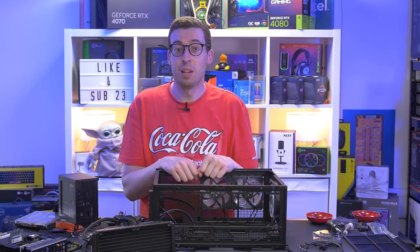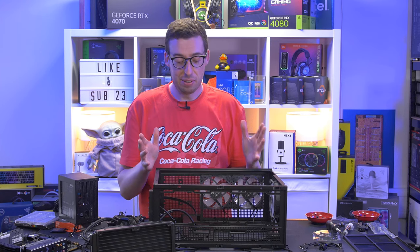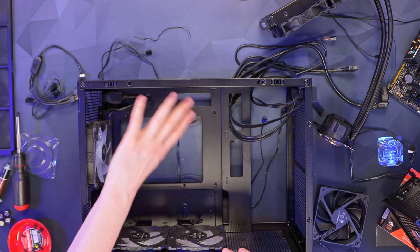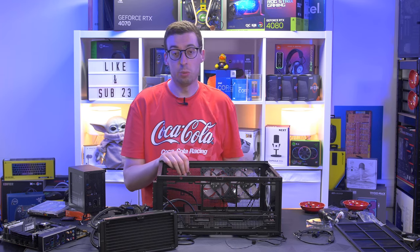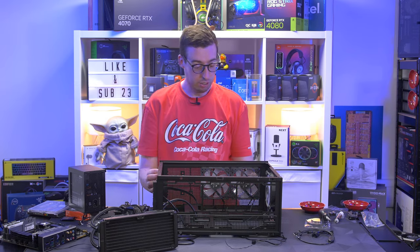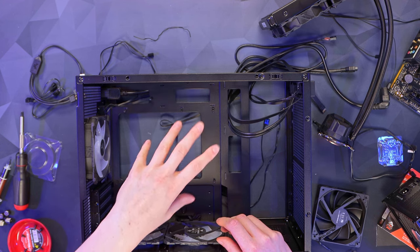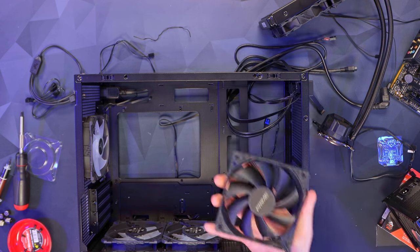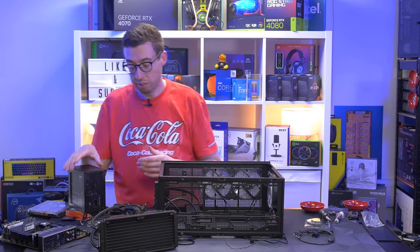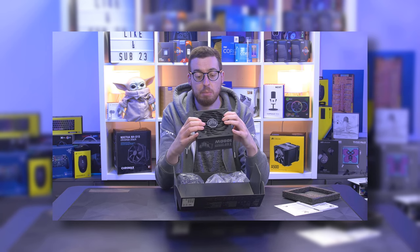I just recorded finishing this build for a good 45 minutes without any sound, so I've stripped everything back and I'm going to tell you about a few little changes I made. I've installed additional fans: one at the rear to match the nice lighting on the AIO, and two in the bottom with the logo facing down so air is drawn in from underneath through a filter — that'll help keep the graphics card cool and feed some air up to the AIO. We're also using the Asus TUF 1000W ATX3 power supply — 10 year warranty, 80 Plus Gold.